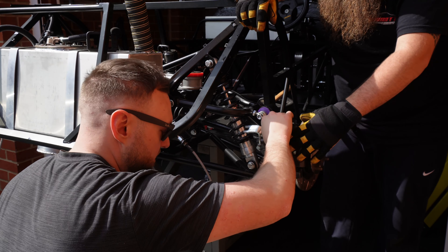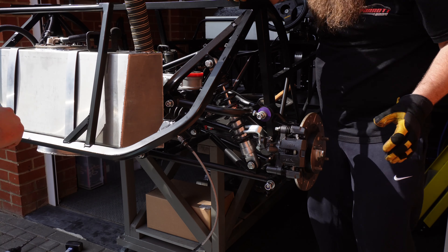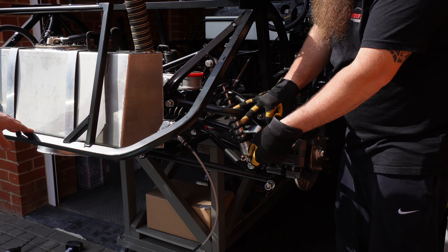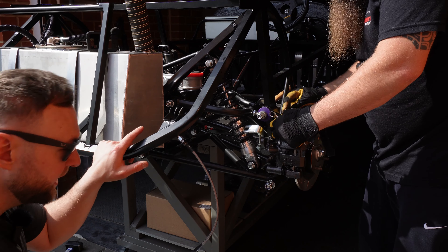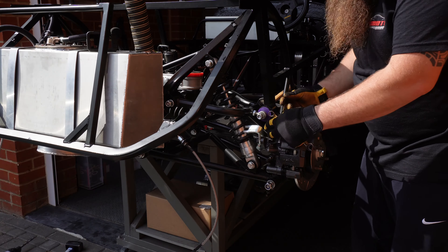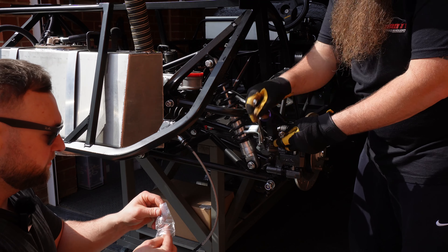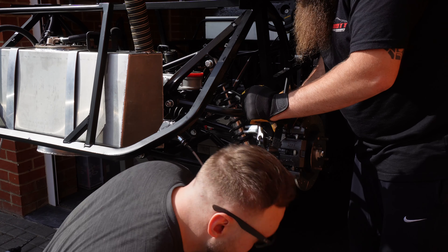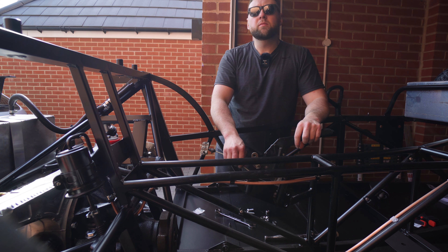I pushed the bolt out and it had grease in it already. What size do we reckon that is? It's a 10. There are also two other little springy clips we've got to put in - they just look good. And there's a little cap that goes over it once it's done. Now we move on - we've got the caliper on with the pads in and everything ready to go, ready to take the handbrake cable.